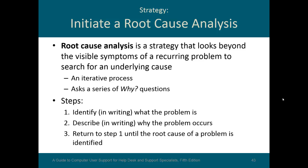Let me go to the toner cartridge. I shake it. Is anything in there? All right. Let me put that back in there and try that again. Okay. Hey, now I'm starting to see something. Or I'm still not seeing anything. Let me pop in a new toner cartridge. Okay, hey, that seems to fix it. So this other toner cartridge, even though it has toner, is bad.